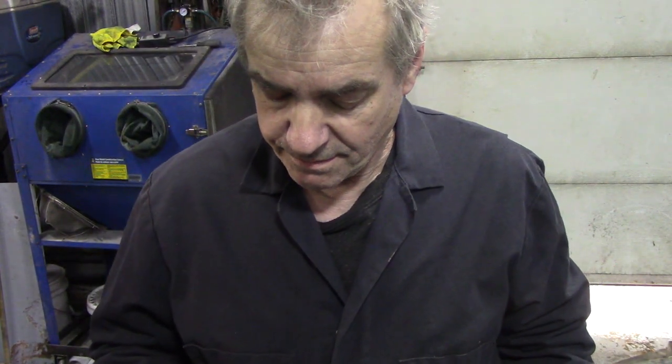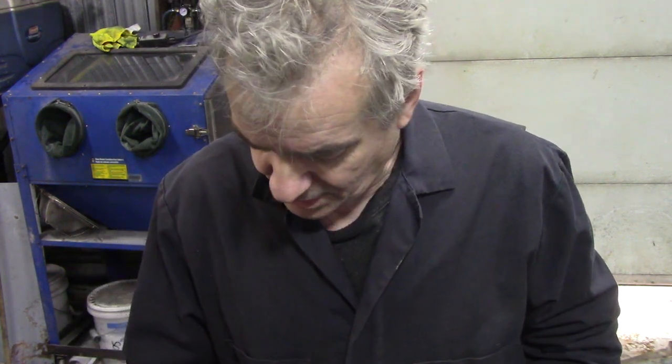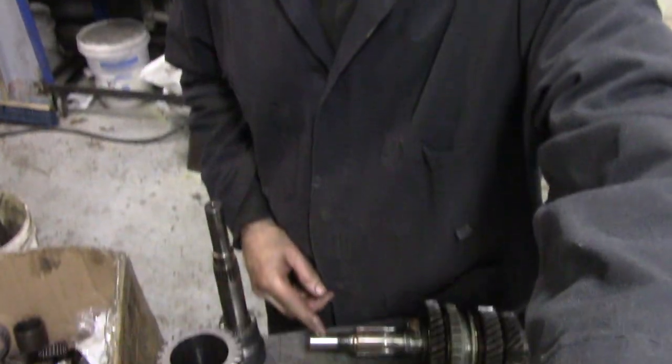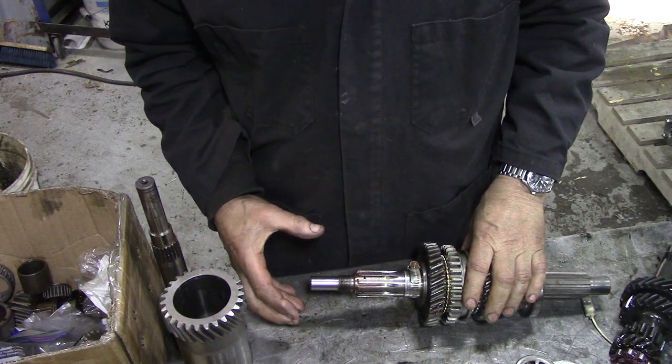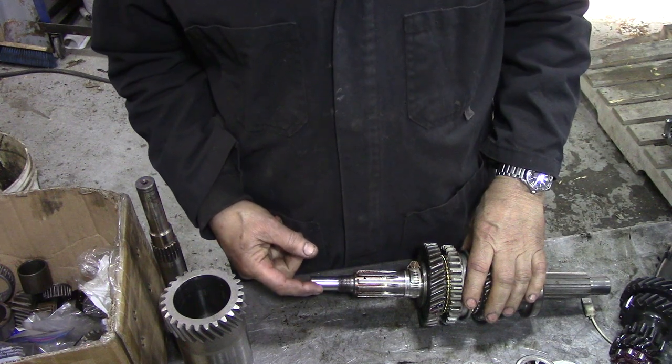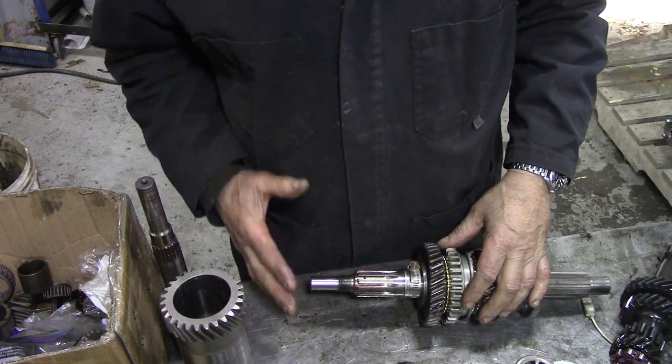The problem now is we've abandoned the idea of doing the overdrive, because there's a used one in the UK for 750 pounds - this is putting the project way above the price of a Roamadrive; you might as well buy a new Roamadrive. So we've machined the shaft here, but now we're looking for a PTO cover to go on the end which has a needle roller bearing in it, and we've machined this too small. That means we've got to change the shaft and find the gear and find the cover - I've got nothing like that in stock.